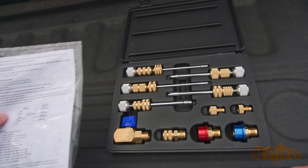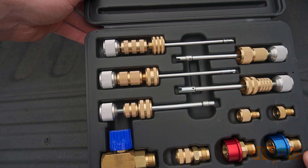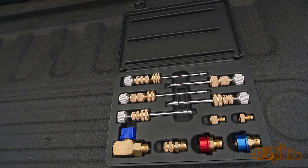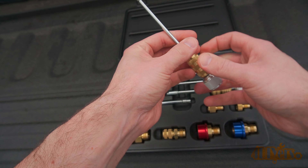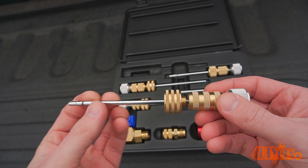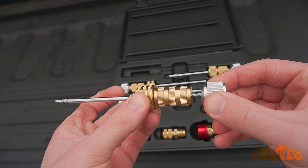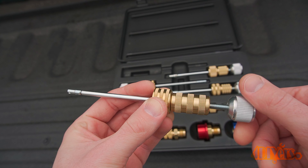To start off, this comes with a hard plastic case where all the components are safely stored. This is their larger master kit — they have cheaper options available as well. This kit includes the R134A high side 16mm connector and low side 13mm connector, quarter inch FL swivel connector, standard valve core shaft, GM large bore valve core shaft, JRA R134A valve core shaft, Eaton R134A low side and high side valve core shafts, adapter quarter inch male to 3/16 female high side for GM and Ford, and adapter quarter inch male by eighth inch female high side for Ford.